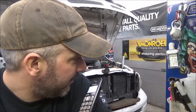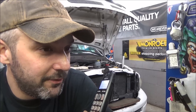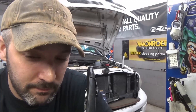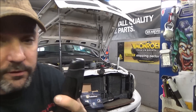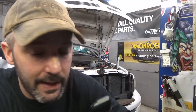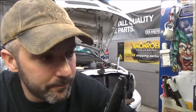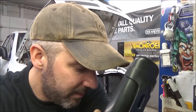This is Eric at South Main Auto. I'm working on a 2002 Dodge Ram with a 5.9 in it. I bought a Napa compressor for it and I'm having a little bit of problems hooking the hoses up to it — wondering if you can give me some insight. The part number is 275-612. Yeah, let me look it up. That is the number I actually have. That's the one they sent me. The hoses appear too long on the discharge side. You're saying you have an issue with one of the ports. Yep. The suction side is fine — the discharge side just seems to not be machined deep enough. Maybe I'm lacking like a sixteenth of an inch.